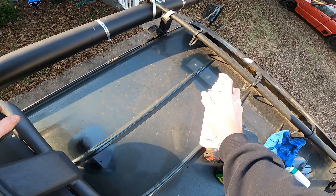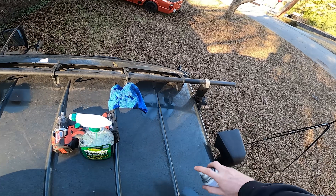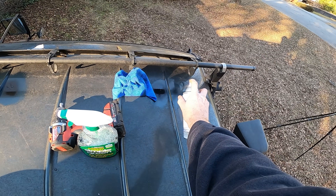Before I actually mounted the solar panels or the pass-through or anything like that, I went ahead and painted all the holes that I drilled with some black spray paint just to prevent rusting. It's going to have some silicone over it and some other stuff to make sure no moisture gets to it, but you can't be too careful — especially when you have an old JDM car that happens to be rust-free. You don't want to ruin it.